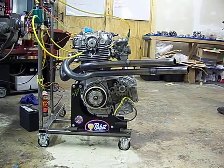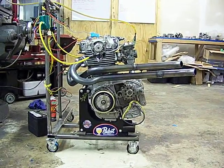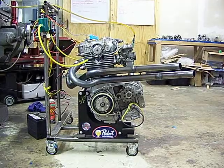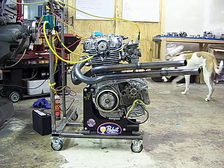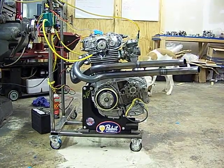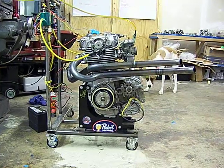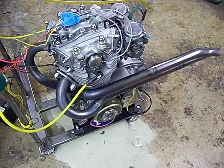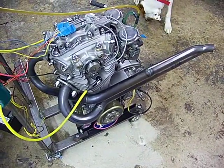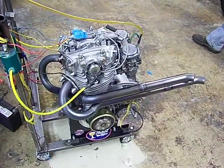What we have here is a factory long rod early motor — 256 motor — been rephased, but we left the rest of the internals 100% stock, so we haven't modified that at all. This engine goes in Tevin's restomod cafe racer, but Dan over at Pandemonium Customs wanted to know what a rephase would sound like with a set of his pipes, so we put a set of his Yo Mama pipes on here and Roxy is seeing if she likes them. We're gonna fire it up and let you guys check it out.